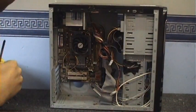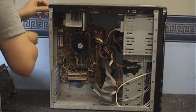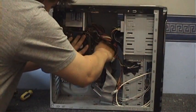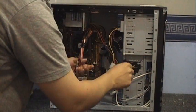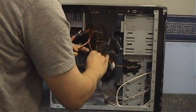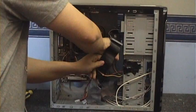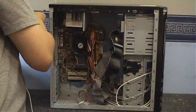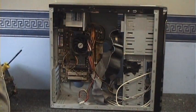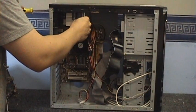Let's see what we shall remove first. I think we'll take this old power supply out. We're not going to be needing this — should really unplug it first. Maybe cable management would have been a good idea as well. I'm not going to touch those heat sinks though, because this has been on today and although they won't be hot anymore, there could still be high voltage on them.